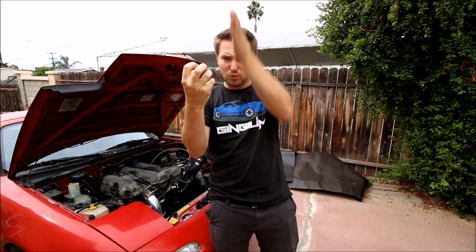So imagine you have your engine bay right here and you have your radiator. You have fresh air coming in from the outside trying to get through the radiator into the engine bay, but if you have too much pressure here, the air can't efficiently get through that radiator. So if you don't have a splash guard, you need to install one on your car.